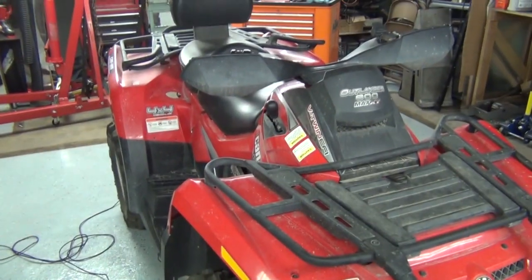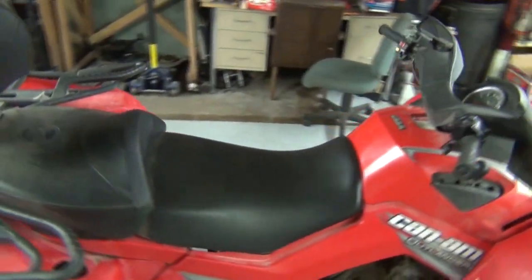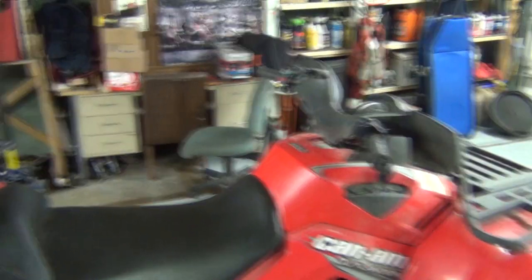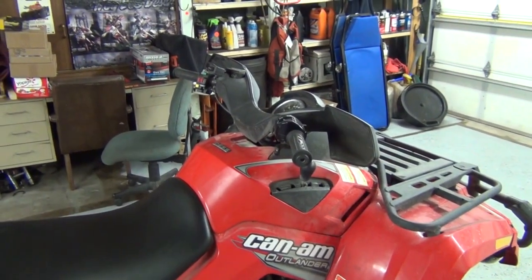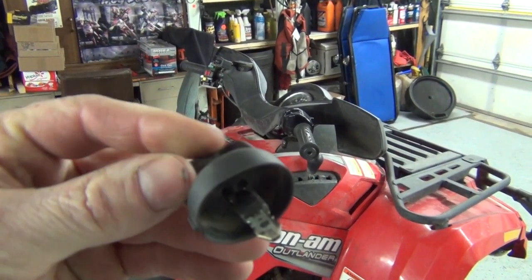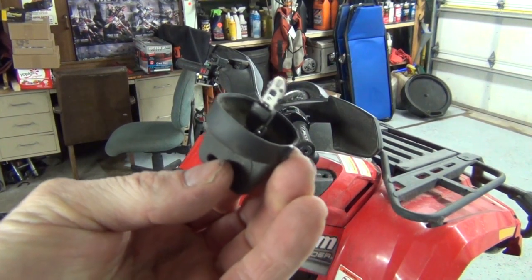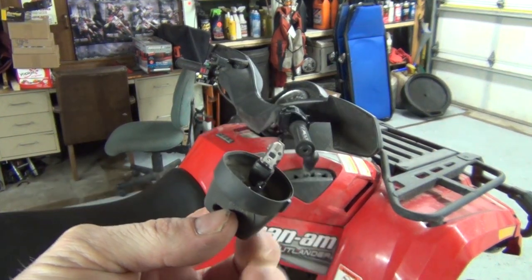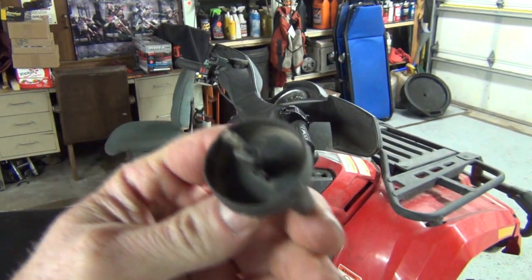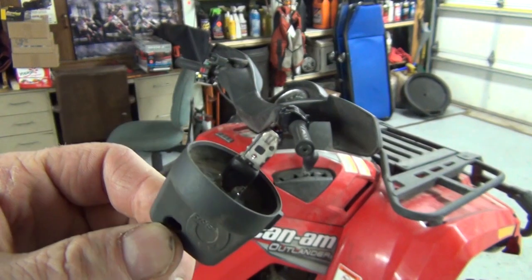It's just not starting. When you go to put the key on - this one's a little bit on the complicated side. It's fuel injected and has an anti-theft key. This is the magnetic or RFID key. All the keys are the same; they're just programmed to the bike through the computer, through the little DLC at the back. This key is all jacked up, and so I had reasonable suspicion that this was the culprit.